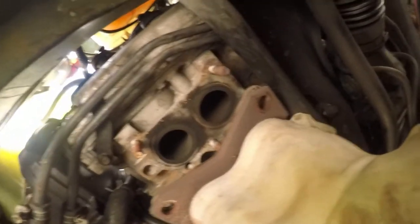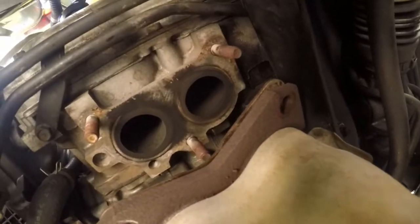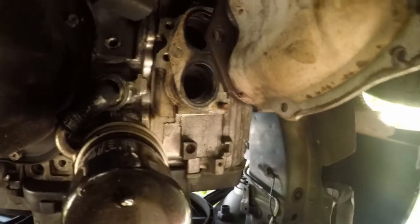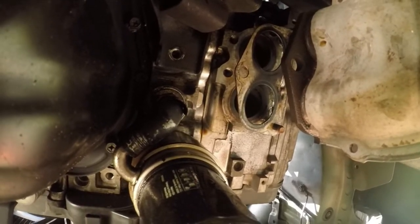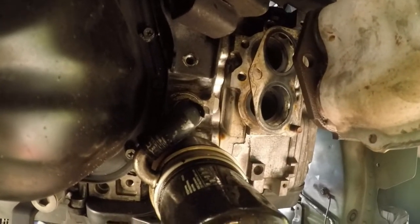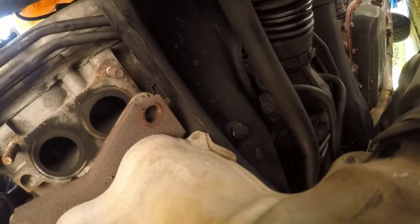The heat shield — somebody had tried to fix it before. Honestly I would have just ripped it off; all it's gonna do is corrode even more and it's already making noise, so there's no point. Now that we got the headers off, we can access the bolts pretty easily. The only thing is this is going to be a project later on — as I mentioned in my initial introduction video, EJ25s are notorious for head gasket problems from the factory. Eventually we're gonna have to change the head gasket on this motor, but that's a big project and we don't have all that money right now, so we're gonna wait on that one.